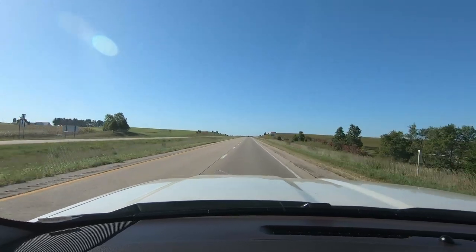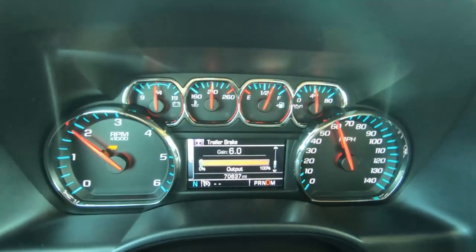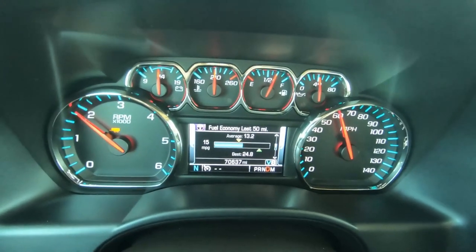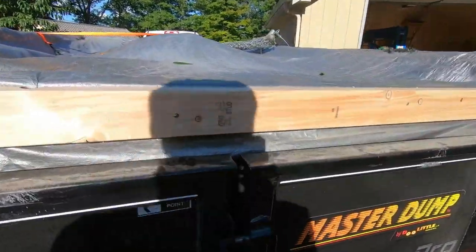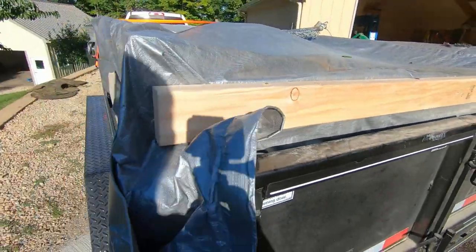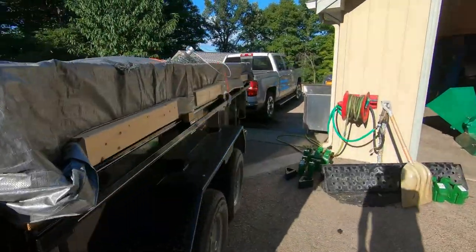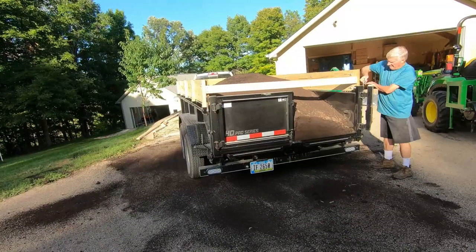Going up the highway doing 58 miles an hour — radiator's good, got a full load on here. I put the gain at 6.0, transmission's at 185, so that's all good. I'm getting 13.2 miles per gallon pulling it. Once I got home, the tarp really proved to be effective — I cinched things in and that tarp just couldn't blow out. Couldn't beat the sides up of the trailer using bungees, so this is really a terrific way to haul this. I ordered a custom canvas for this, and I'm going to be able to do a lot better with that in the future.